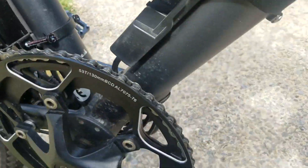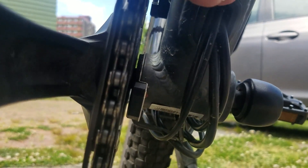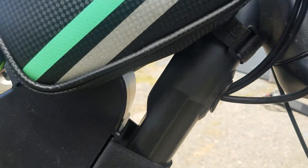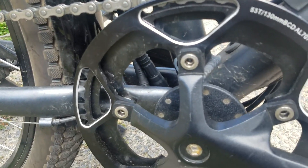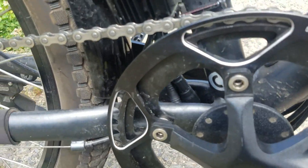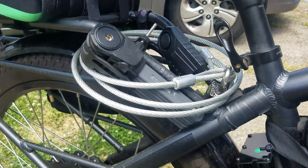When you're installing this controller, down here there's a wire connector — pull this rubber plug out. If you take the main cable and push it down through the hole, that'll make it a little easier. Just push that back in the frame, and the one connector down there, pull it out a little bit — that's the only one. That's your six-pin connector coming from your display, brakes, and everything.